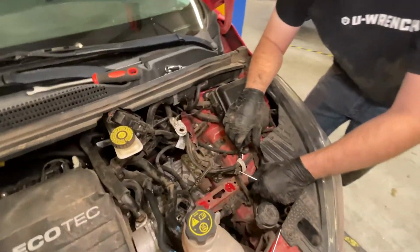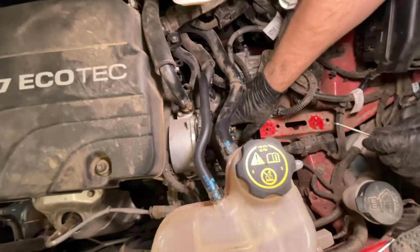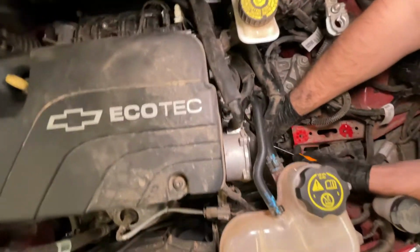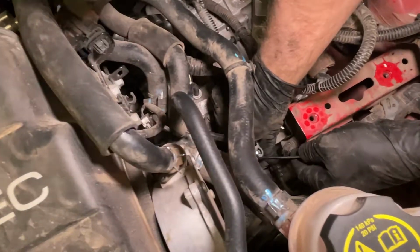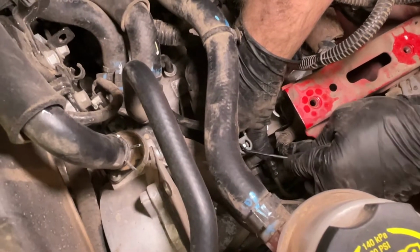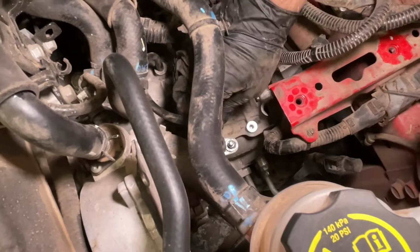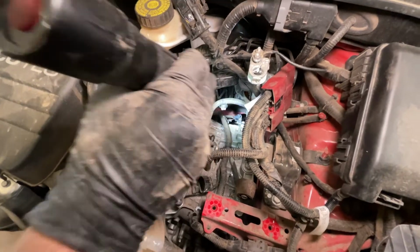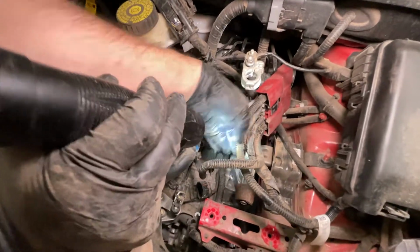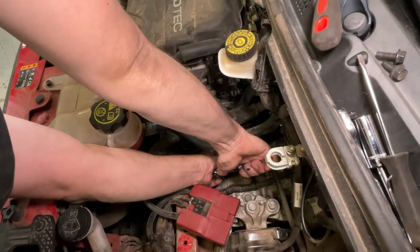I'm gonna take off the shift selector cable. It's gonna be a little different. So I have this pick here. I'm putting it in the side, twisting outwards so that it opens up, and then you just pull up on it. There's a connector in the back by the firewall. Really easy to pop off. It has a couple of these zip tie clips. You can see the other one way back there.